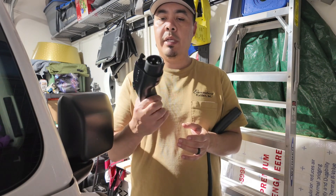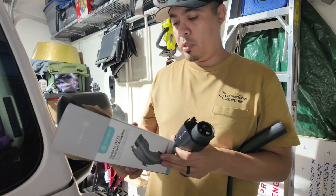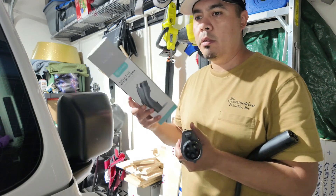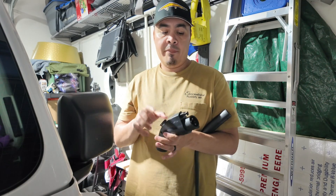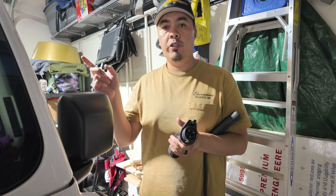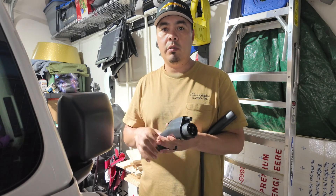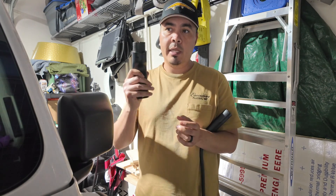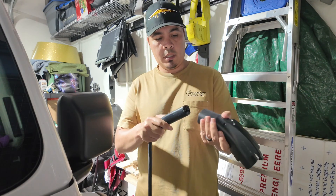The first thing I'll tell you is it has good weight — it feels sturdy and doesn't feel cheap. It states that it supports fast charging up to 48 amps, which is perfect because that's what we have installed here. Quick note: this is NOT made for supercharging. You cannot take this adapter to a supercharger and charge your Jeep or any other J1772 vehicle with it. It is restricted to 48 amps, so please keep that in mind.